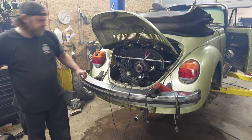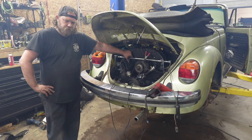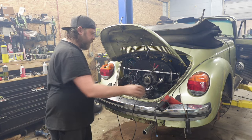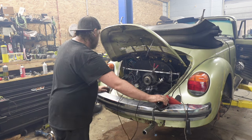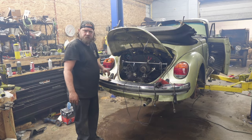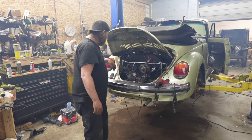That damn shroud. It didn't miss much. I raised the idle. It's bad. I had resynced them. Everything's as good as it can be. Idle's still set where I wanted it to be. But driver side, tailpipe here, because I can isolate the sides again. Driver side, smoke. Passenger side, not that much smoke. Whatever white is coming out of the driver side is like burning oil almost.